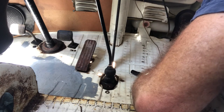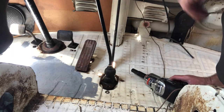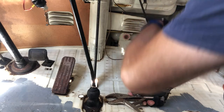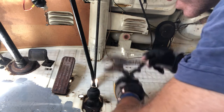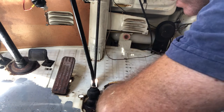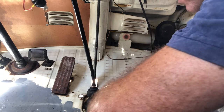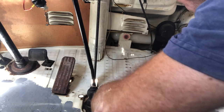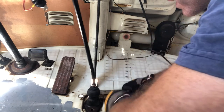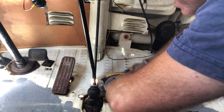No luck with the impact wrench — it was just spinning, I think it stripped the threads and just spun. One other technique that seems to be working after hammering it with the impact wrench is to use a pair of good old vice grips. I must have loosened it enough with the impact wrench where it's actually turning, albeit very slowly, with the vice grips. With any luck, hopefully I'll be able to get this guy all the way out.